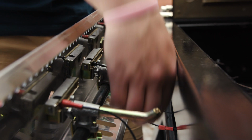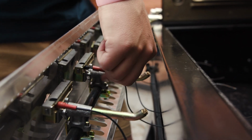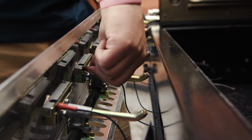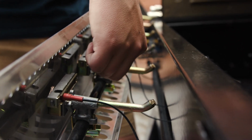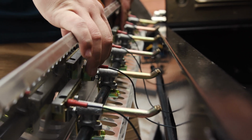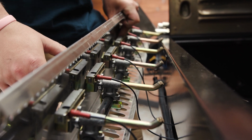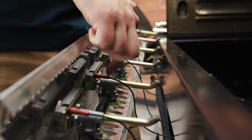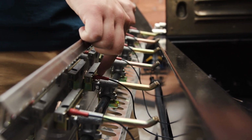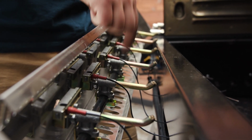The other thing is it's going to have these silicone sleeves right here. I'll pull it up and just make sure that those are going over the top of that black part on the valve right here. That's going to make sure that it doesn't shock anywhere else except for at the end of the igniter. Now don't worry if yours aren't this orange color, they also come in clear. So as long as you have this valve cover, this silicone sleeve, you should be good.